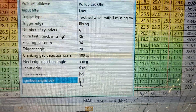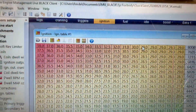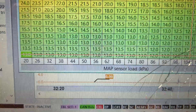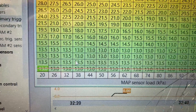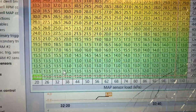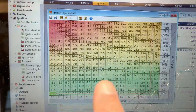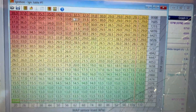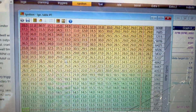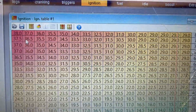Once you uncheck Ignition Lock, it goes back to your ignition map. So if you're idling in that area, it'll give you around 13.5 degrees of timing before top dead center. This map is for a K24, so it's not what I'll be using on this engine. I'm going to lower all these values maybe 15-20%, because I'm probably not going to be running 34-35 degrees, let alone 37 degrees of timing. I don't think these engines can handle that kind of timing.